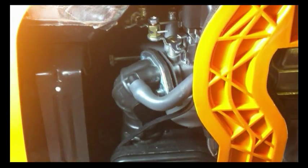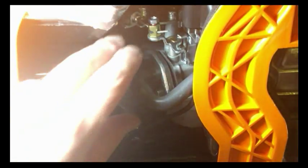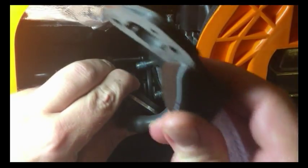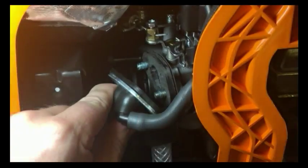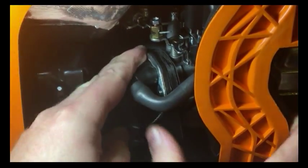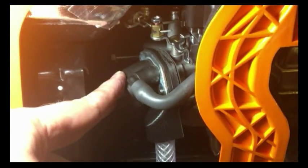At this point, I've got the side cover removed, exposing the carburetor and the snorkel. I've removed the two 10mm nuts from either side of the airbox snorkel. I'll pull this away, make sure that I leave the gasket against the carburetor, and then we'll take our adapter and fit that up into place. You can see that in place there, and then we'll put the carburetor snorkel back over the top of that. Once that's in place, I'll reinstall the two 10mm nuts and we'll put the cover back on and go to the next step.